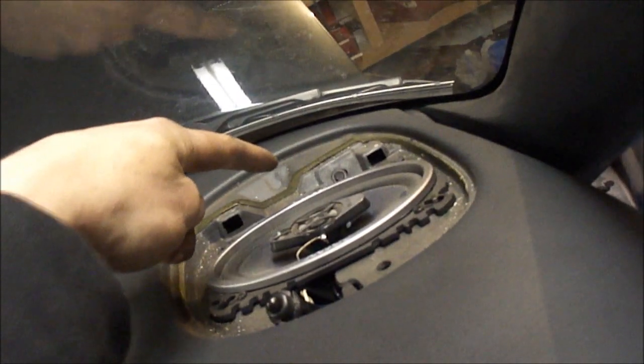So far, once I got the dash pins lined up on each side, I tilted the dash up, and to hold it in place, since I'm doing this by myself and had nobody to hold it, I threw one dash screw in there and then went to the other side and threw the other one in over there underneath the speaker covers.